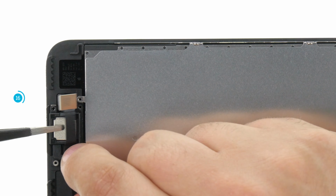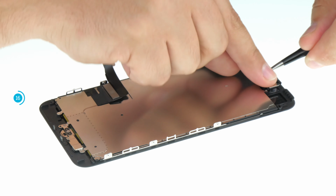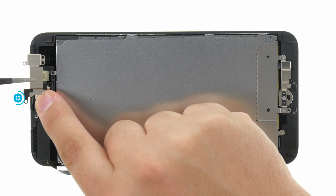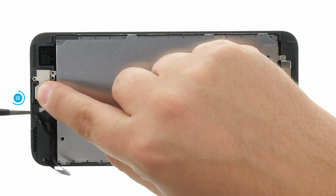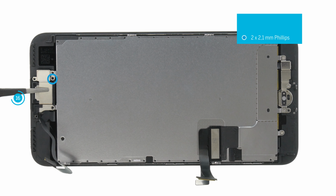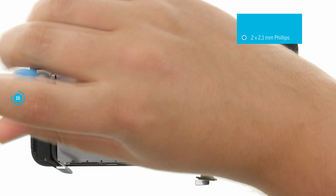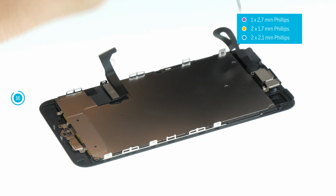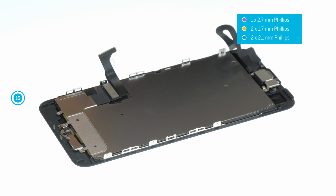Then insert the front camera into its opening and keep holding the whole thing in place. Put on the cover plate and hold it tight. Then insert a screw and fix the plate with it. Then insert the other screws as well. Take care not to tighten the screws too much and do not swap the screws.